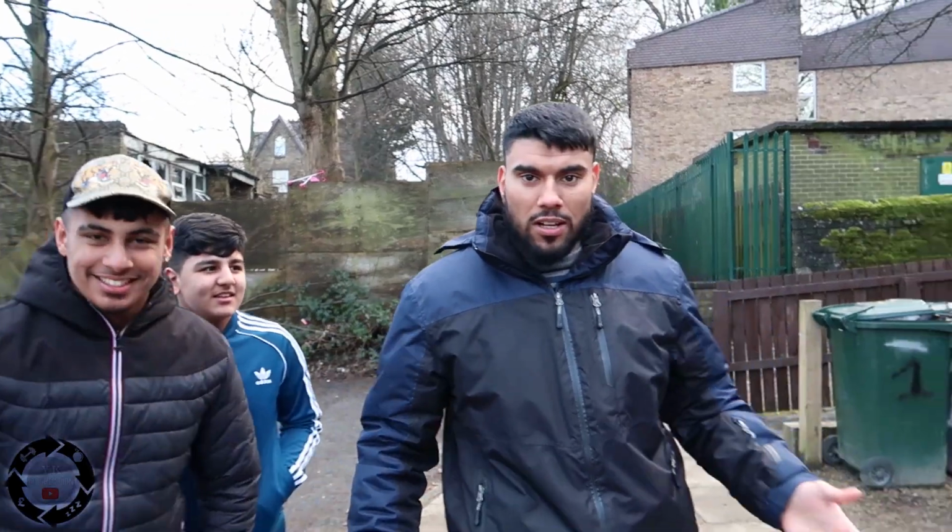Yeah, so we're here. Let's make a start. What we're going to be doing first is, I think personally, check the fuses, put the spark plugs in, check the coil packs, and then see if it fires up, because I've already put fuel in it from the last episode. So yeah, you ready? Ready to go, mate? We're ready.